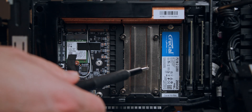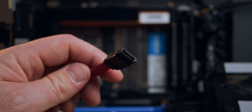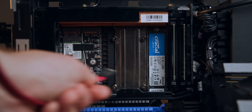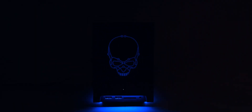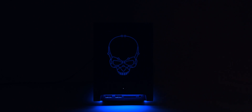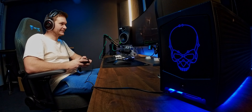The negatives of the NUC Xtreme are that your CPU is paired with the motherboard — it's not intended to be upgraded over time. There are no SATA headers on that motherboard, so you can't use a 2.5 inch or 3.5 inch drive internally — those would have to be external devices on your desk. For personalization, you're limited to the RGB underglow and the skull on the front. There's no side panel, so if you want a glass panel showing off RGB RAM and GPU, because it's so compact, there's not a lot you could really see anyway.